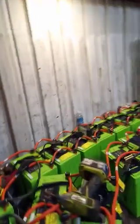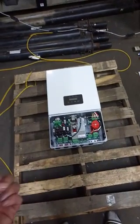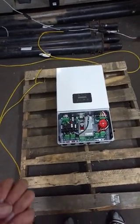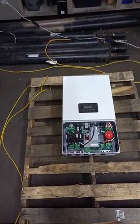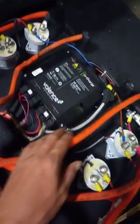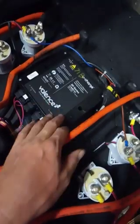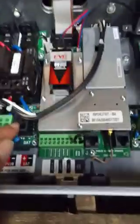Apparently it communicates through the CAN bus to the battery - they do a digital handshake. They say, hey, are you ready to turn on? I'm ready to turn on. Then they both turn on at the same time. These batteries do have CAN bus communications through the BMS. So this will connect the relays and the pre-charge resistors and do all that when it's commanded to - when I put 12 volts to this wire, it'll turn on. When the relays get connected, boom, batteries get connected. Look at how tiny those wires are - I swear that's maybe 8 gauge.